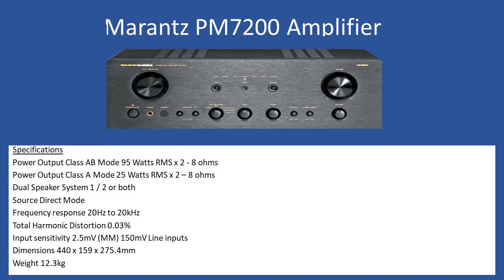When you look at the layout of the Marantz and the quality of the components, you don't have a lot of the issues associated with NAD, where you have low quality capacitors literally mounted directly to the power components, causing a lot of age-related issues. With the Marantz, the design really is just excellent.